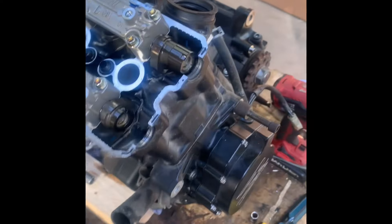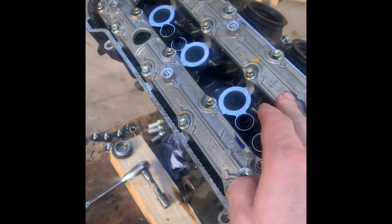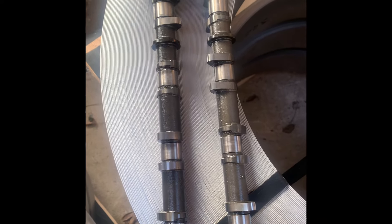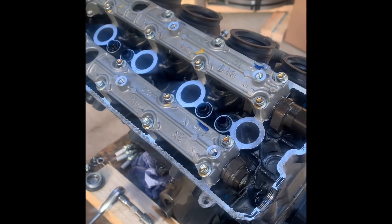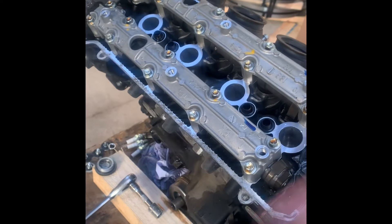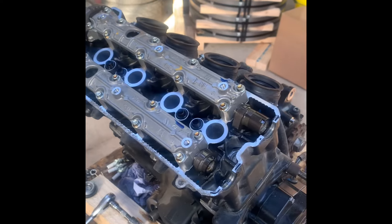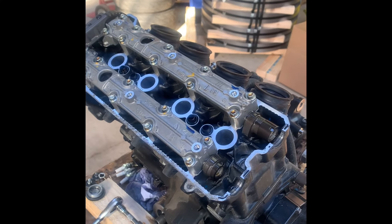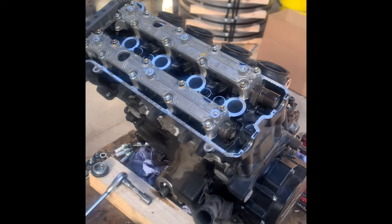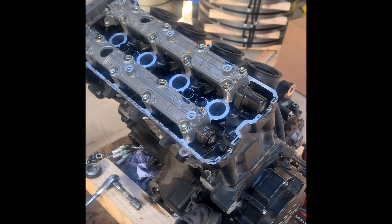The last bit is the camshafts. There is no pin on the GSXS, but because it's standard fitment you can fit a standard set of K5, K6 cams straight in - I've done it and it works perfectly fine. I normally run all GSXR management and swap the cam cover over for a GSXR one, which bolts straight up. All the mount holes line up exactly the same as the GSXR. So with a bit of work, you can swap the GSXR rods, pistons, cams, valves, and valve spring retainers, and bring a GSXS pretty much close to a factory GSXR without a massive amount of work.